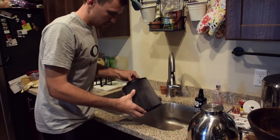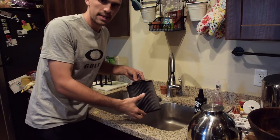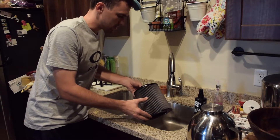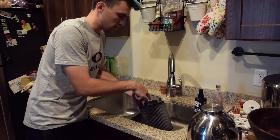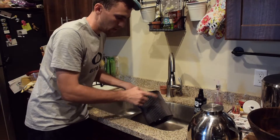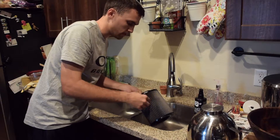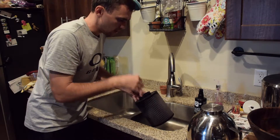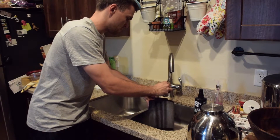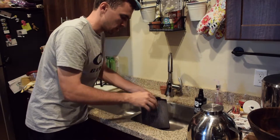The filter has been sitting for about 15 minutes — everywhere recommends about 10 minutes to let the cleaner soak in. The key component for this step is that you need to spray the water from the inside of the cone and press the dirt and particles out. You don't want to spray water on the outside and push dirt into the clean side of the filter. You want to be spraying it out toward the intake side. So I'm going to put this sink hose in here and spray with soft pressure to push out all the extra dirt.